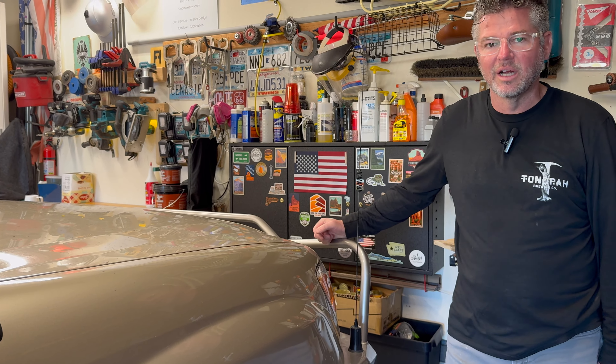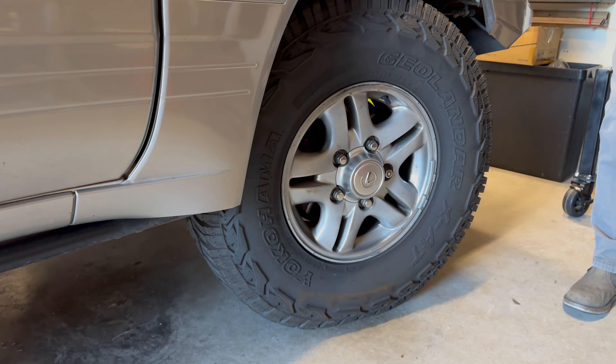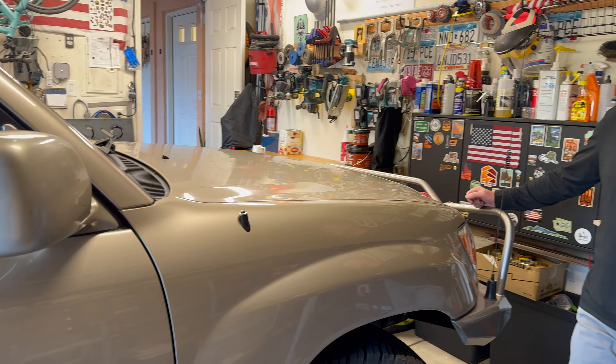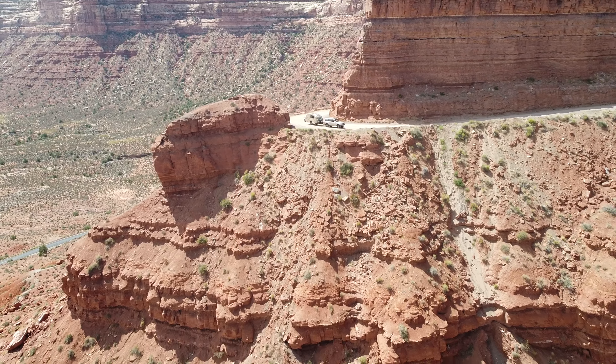One last tip a buddy gave me who's been a Land Cruiser guy longer than I have: over-inflate the tires by about 10 PSI. Factory says 32, so I run them at 42. It makes the tires wear much more evenly — it's a big, heavy vehicle that still flexes the sidewalls just fine. It just makes them wear more evenly, handle better, and I like the way it runs. So there's the 100 series. I am sold on Land Cruisers. If you have any questions or suggestions, welcome your input — you can make some cool things too.